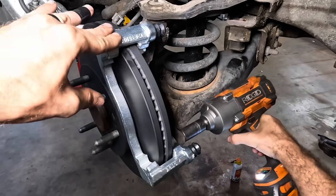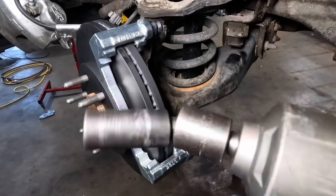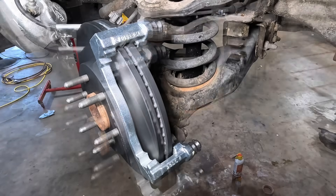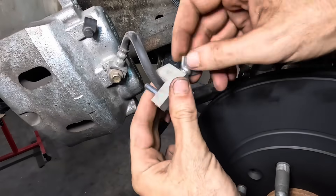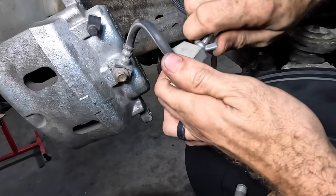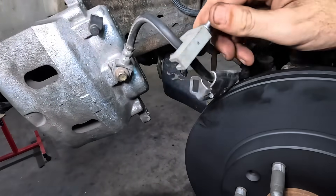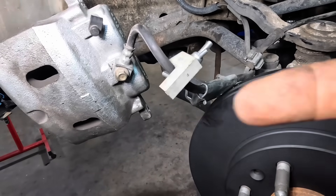18 mil coming in, let's get this guy tight. I need a universal — in comes the wobbly bits. Let's scooch it over and get this caliper removed and tossed back in the box. I've got a clamp here to clamp off the hose — it'll keep all the fluid from running out. I'm going to do a full system brake fluid exchange on this because that fluid was nasty. This fluid inside these lines is all burnt up and cooked, so we're going to flush it out with some nice new ultra-dry BG fluid. Not sponsored, that's just what I use.